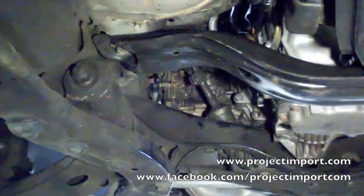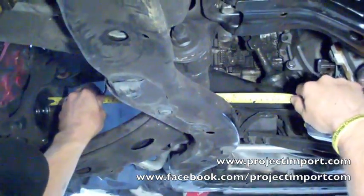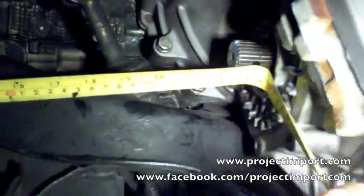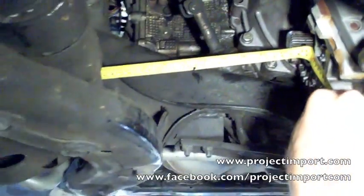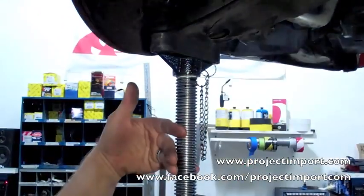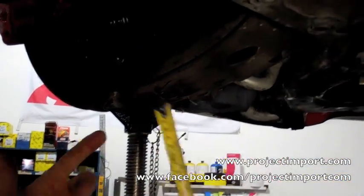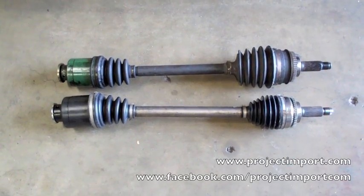What we're looking at — as you can actually see — I have a right side axle in the car and we're looking at the left side axle. I've got a measuring tape here. The front lower control arms, the front spindles, front brakes are all still in place. From this point to the outer knuckle, we have a 23 inch length. I have the suspension compressed in an upward motion, trying to manipulate as if the car was sitting on the suspension. So I have a general length of 23 inches.